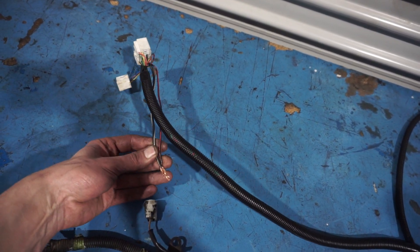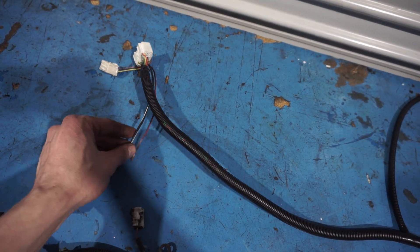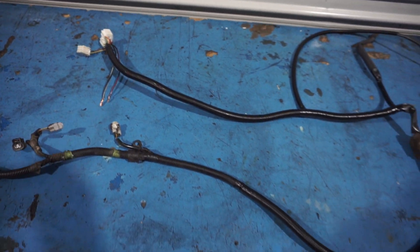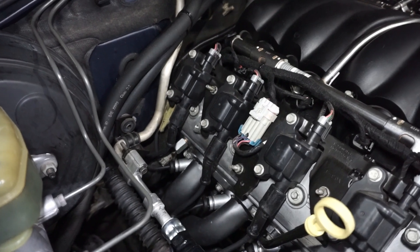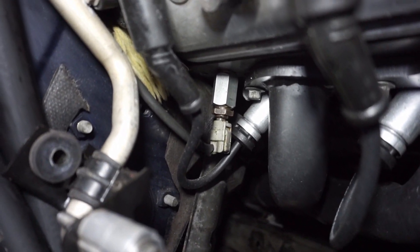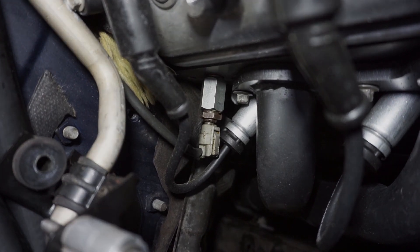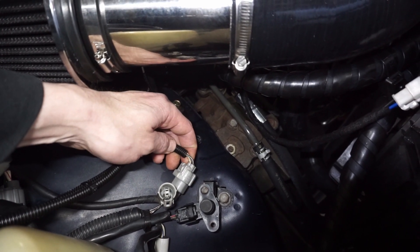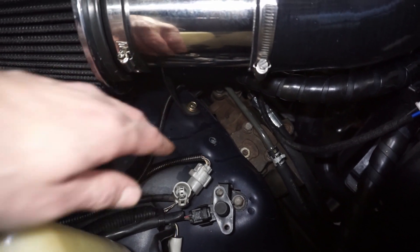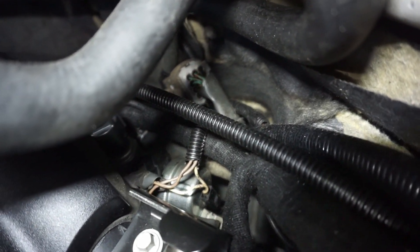We've got our section going down to the transfer case all taped back up, as well as the coolant temp and earth wires. We also have our other two white plugs that go into the body harness and the starter trigger wires that will interface with Allen's harness. On the back of the driver's side head is where we fit the factory coolant temp sensor from the 1FZ — that's where we plug in the green wire. Down on the driver's side inner guard we'll find the oil pressure switch wiring — the brown and white wire will need to be extended and run to the back of the engine.